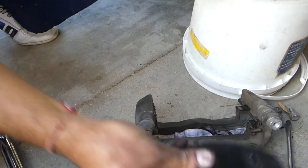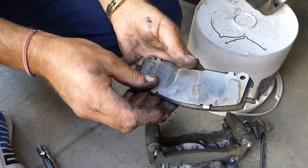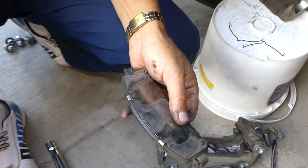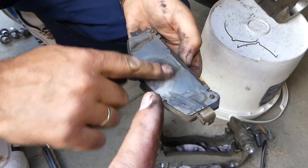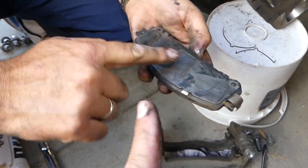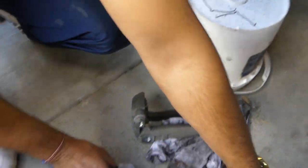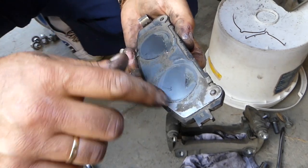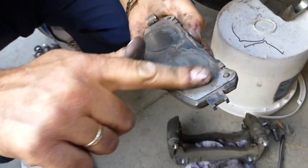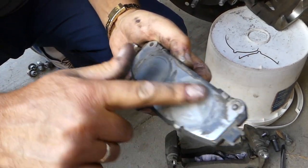We'll apply just a little bit of brake grease — you can find it in the description below — on the glides and also on the brake pads. You can get new shims as well if you're replacing them. Where the brake caliper contacts the brake pad, apply a very thin layer of brake grease — that way you'll have nice quiet brakes and no rattling. Just make sure it's super thin because otherwise dust will accumulate there.